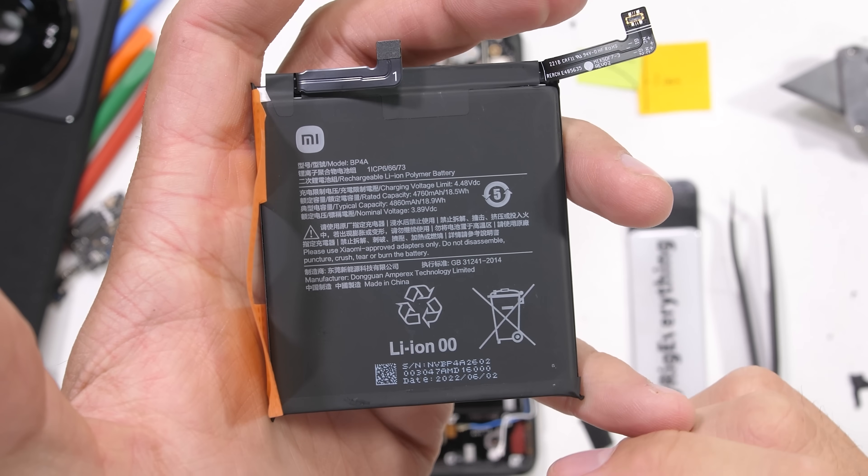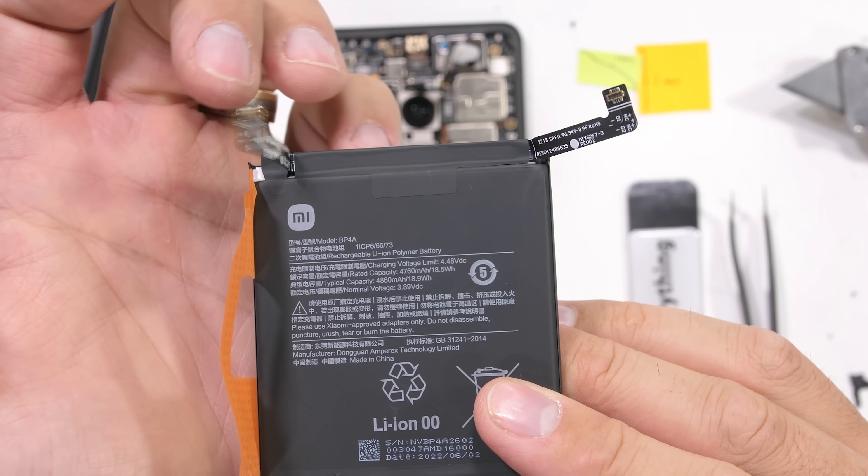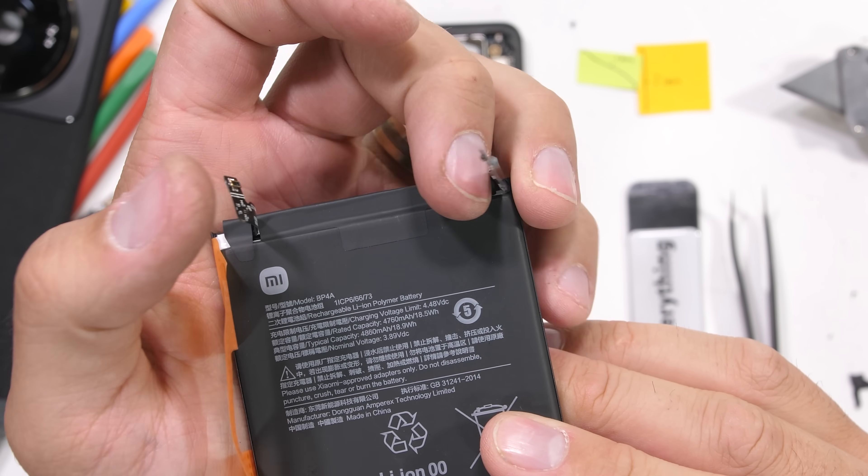The remaining components in the lower portion of the phone are the waterproofing mesh screen over the loudspeaker opening, the square vibrator motor, as well as the white water damage indicator sticker next to the SIM card opening. The battery is easy enough to remove — no prying or alcohol, just a little tug. Samsung could learn a thing or two from Xiaomi about attaching batteries. This guy has a 4860 milliamp hour capacity and has two plugs on top for the extra fast charging speeds.